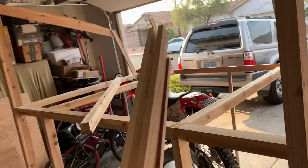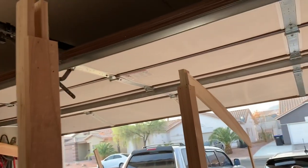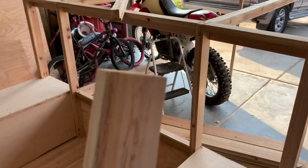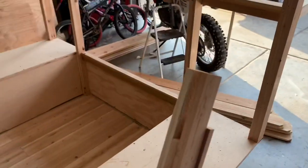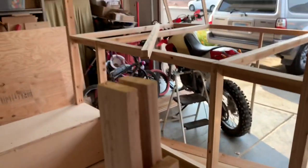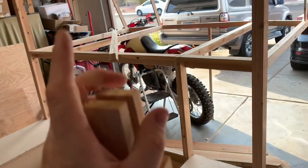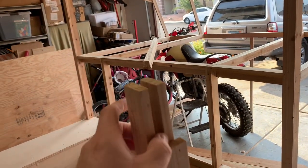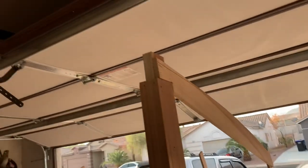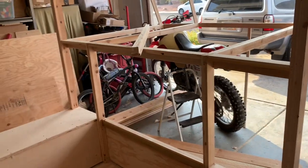Here is a piece that I'm finishing up, and it's going to sit roughly there, so you can kind of imagine, and this is going to form the frame that goes back into the rest of the camper area. Another advantage of laminating these together is it allows me to create these unique shapes that I use when attaching stuff. It takes a lot of forethought, but in this case, this is going to sit in here. The cross piece, which is going to go over the top and form one of the roof trusses, I guess you could call it, or one of the roof supports, will fit down into this joint here. And then this joint is the curved equivalent that's going to run across the top of this roof here. It's a lot of extra work to laminate these.